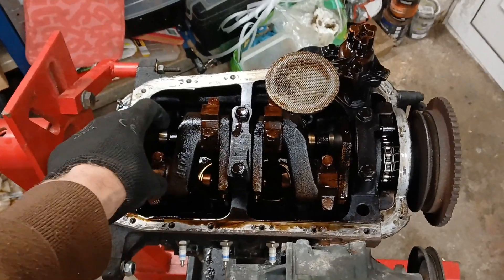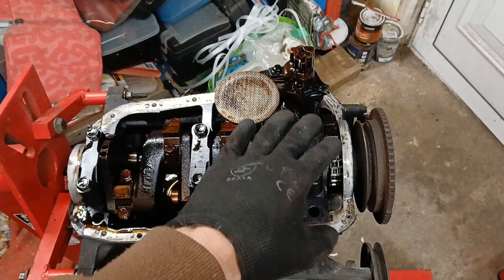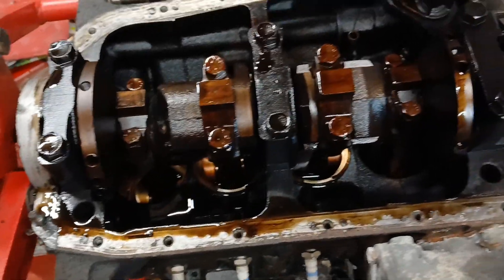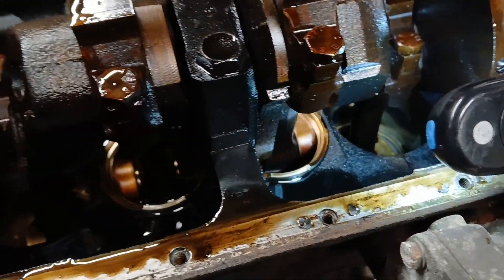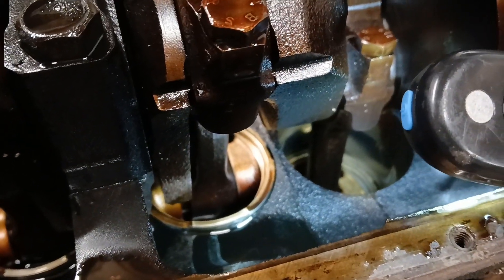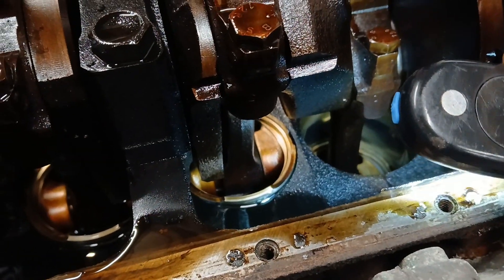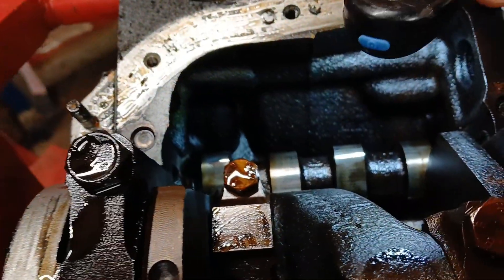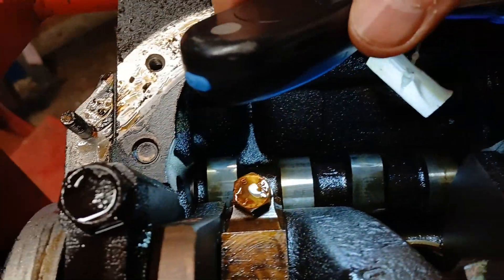I'll have a little rummage through this just to make sure there's nothing terrible looking. Obviously if you're being really serious, you could take some caps off just to make sure the bearings look all right. As a starting point, it looks okay. Another little tip — at least for this type of engine — if you turn it over, which you should be able to do easily, you can also take a little look down and see the actual cylinder walls for each cylinder. You'll be able to see if they're looking super scored or anything horrible like that. And because the cam's down here, you'll also be able to see if the cam is looking horribly worn or has had a lot of heat going through it.